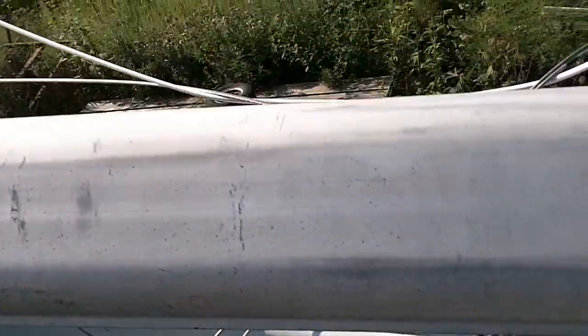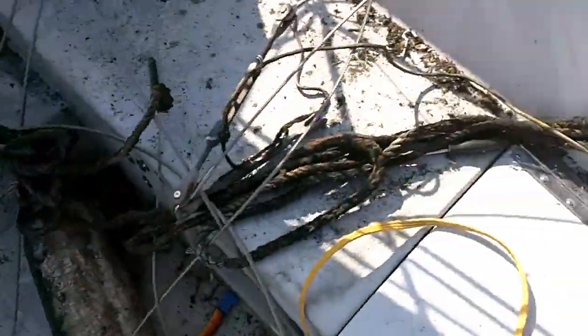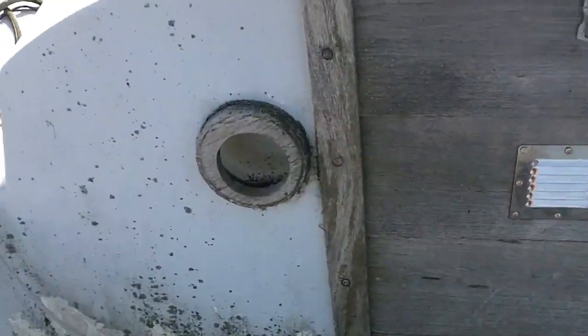What my brother and I did last night is we tried to see if the engine would crank over. That's why you see these items sitting in here — we hooked the jump box to it. And yes, it does crank over. We didn't try to start it. We turned the fuel off to it, drained the bowl, just to see if the starter was still working.